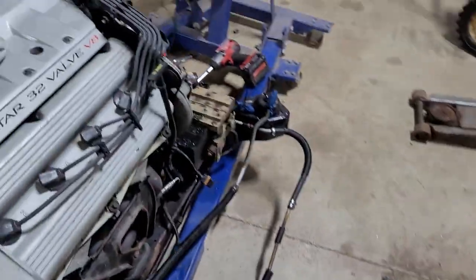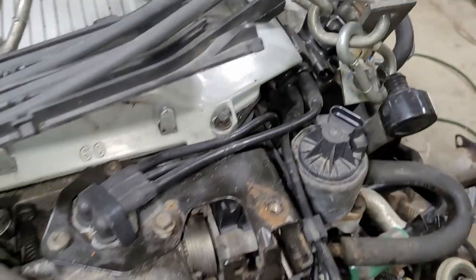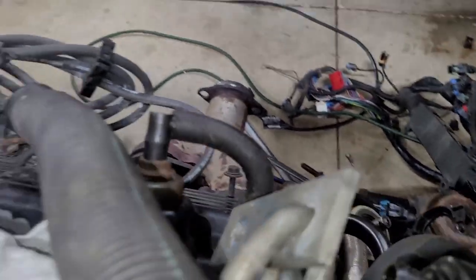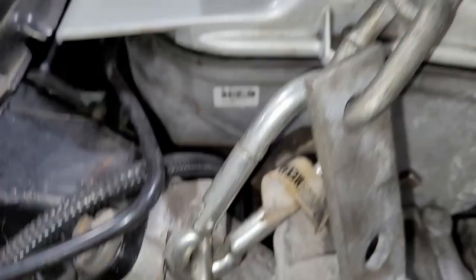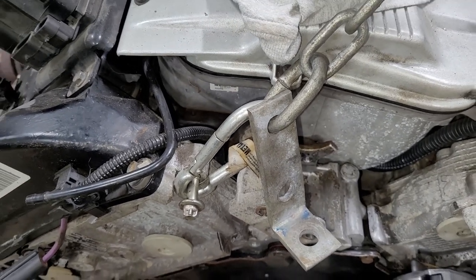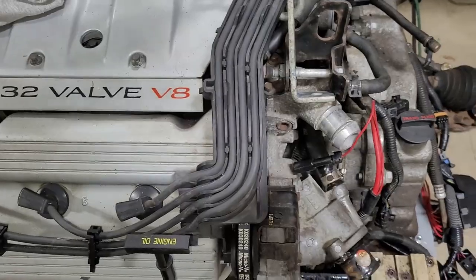And you can see I got the hoist on it. And I pick it up by that bracket, which comes on the engine. I can't really see it. Trust me, it's there. Front dog bone. And then I thread a, I don't know, it's a hardened bolt I found in my junk drawer. And one of those carabiners I like. Get the good quality steel kind of carabiners. I don't mess with the aluminum stuff. And pick her up that way. So I've just got a little bit of pressure on it so I can start to free the transmission up.